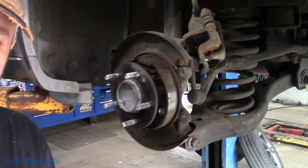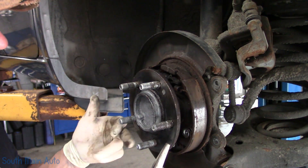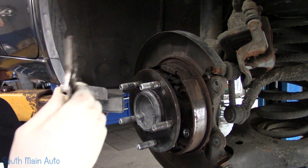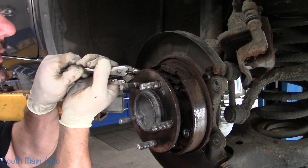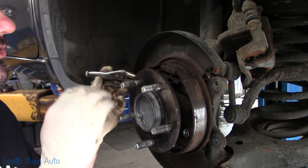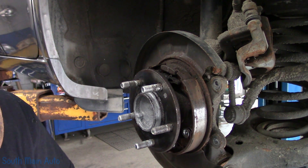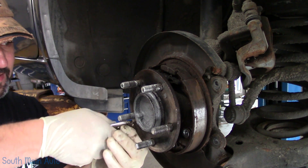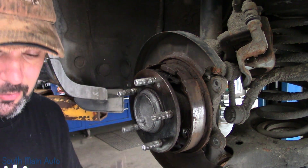It's kind of difficult to get you guys a good angle but I'll do the best I can. You've got an upper spring and a lower spring. Fortunately on these Hyundais, everything's on the outside. So I find the easiest way is I just reach in with a pair of needle nose, grab right on the hook on that spring, pull it back and release it. They don't have a ton of tension. Should be able to slip it right out of there. That's the upper, and then on the lower I'm going to do the same exact thing — that one's got a little bit more beef on it.